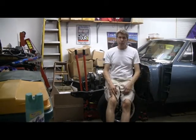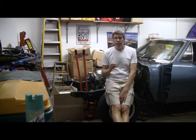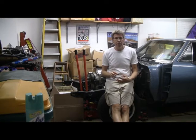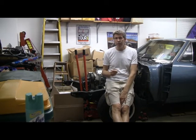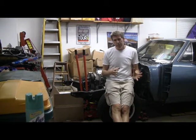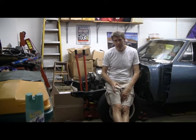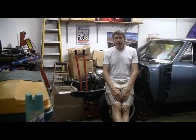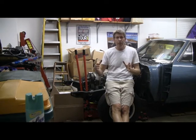So here's the combination that worked for me, starting from the back going forward: stock crossmember for the transmission. I used the Dirty Dingo conversion plates — not the slider plates, just the single conversion plates for the engine mounts. I used the tall frame stands for the engine mounts and then the low but wide motor mounts that go to the frame stands. What that allowed me to do is get the front of that engine down, and the Holley pan allowed me to do that cleanly. There's a bit of a spacing issue with those wider lower mounts on the tall skinny frame stands, but a couple of washers will take care of that.